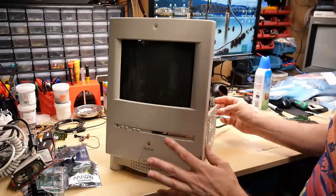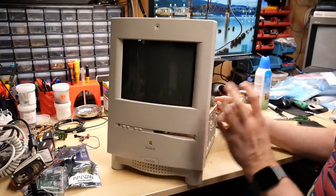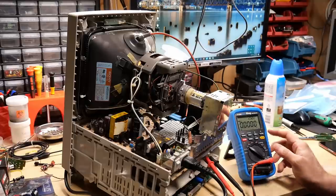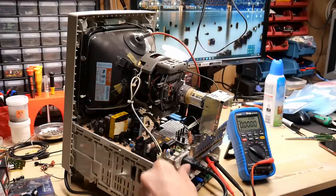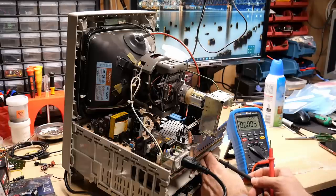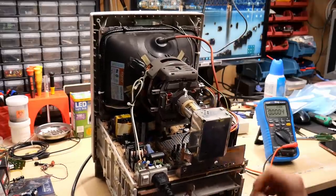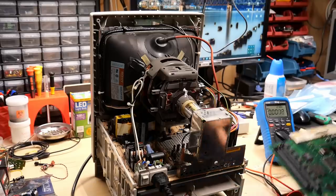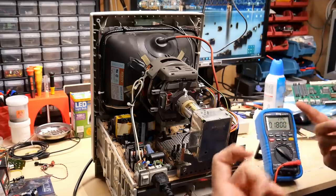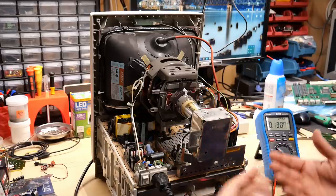I should be able to check that. The hard drive is removed from this computer right now, so I can check the voltages on that connector. Give everything a push — let's try one more time. I hear the power supply start up, but the monitor is not starting and there's no sound and no fan hooked up. I have the multimeter hooked up to the 12-volt rail. We're not even getting 12 volts — well, that would explain a sort of problem. Let's see about the five-volt rail. Point two — yeah. So I don't think the power supply is even running. Let's pull the motherboard out of here. It could be shorting out — let me try it with the motherboard removed. Okay — yes. So the monitor started up. So the bar graph is pulsing — so that could mean that there is a fault on the power supply. More likely though, it just doesn't like having the motherboard at no load, so it will just pulse like that. I bet if I plug a hard drive in it will probably work.